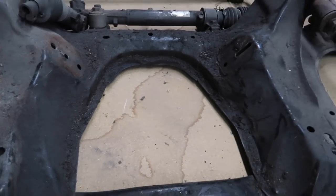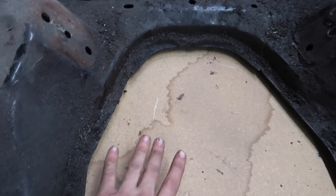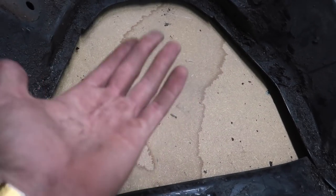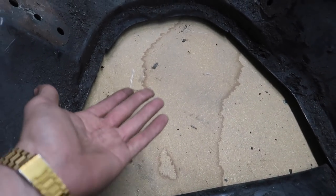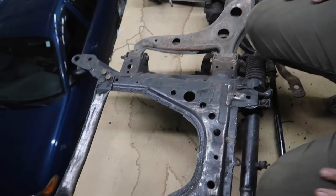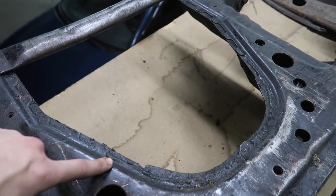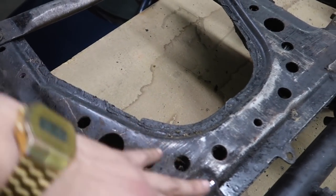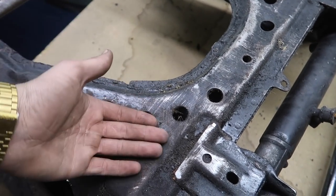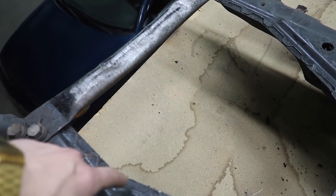Because there's that quarter inch on either side, the whole engine is raised maybe like half an inch, if that. That's one thing to note whenever you buy those pre-made ones — you're barely even raising your engine, and then you've got that skid plate that's really close to it. If something comes and hits right here, it's going to bend enough to hit your oil pan anyways. So you might as well just raise it more or get a thicker piece of plate. We don't want the plate to be protruding any more than is necessary, and we don't care about the subframe scraping. So we're going to put it in this little lip right here.